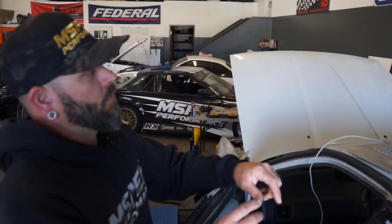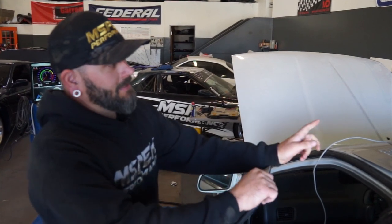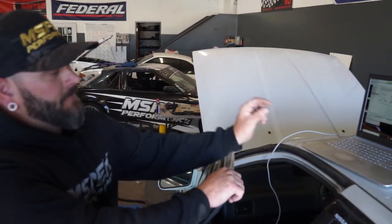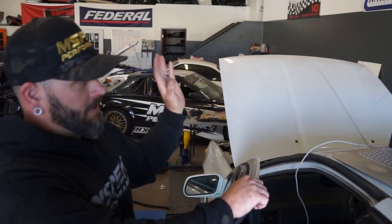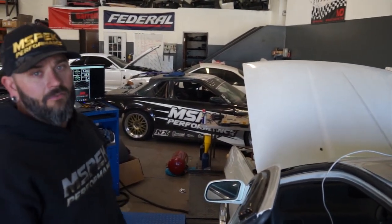AEM does a lot with ignition timing at idle to help hold your target idle. We don't want the ignition timing dancing around when we're trying to set this. What this is going to do is make sure that zero degrees on the computer is zero degrees of engine timing mechanically at the engine. I set it at zero so we don't get any discrepancy from the timing gun and everything can just be zeroed out.